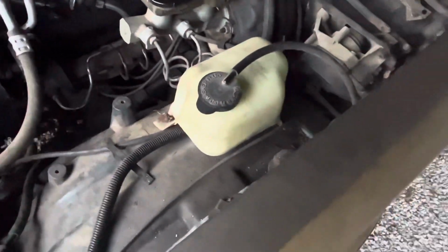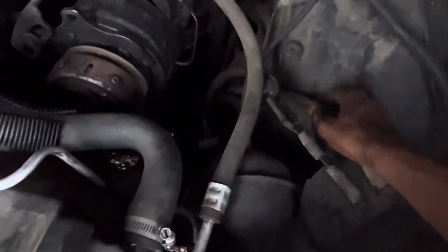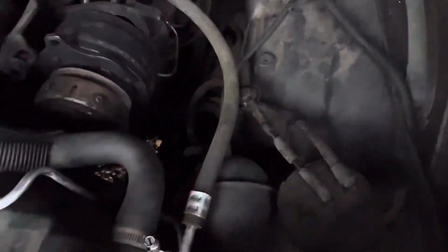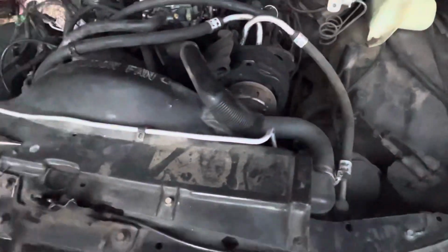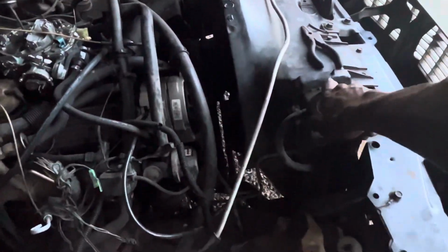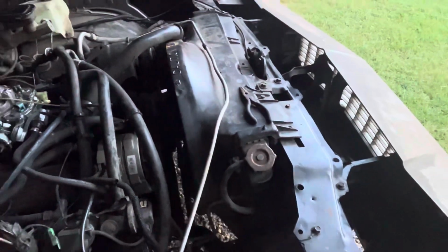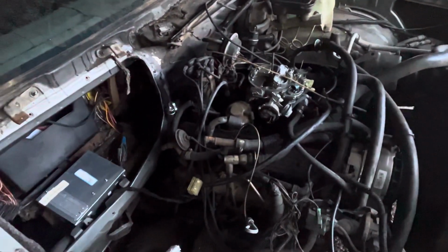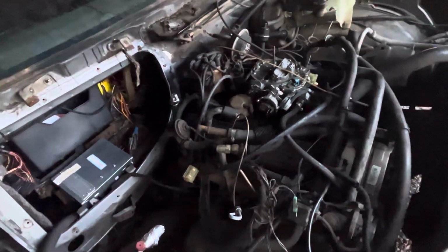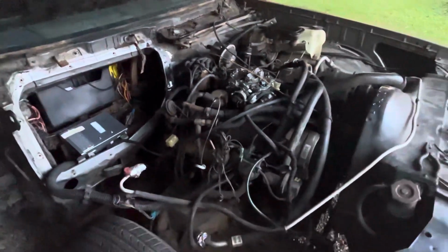And I'm gonna have to test and see if his windshield washer pump works. I'm gonna have to get down there and change that if it's not working. And like all these hoses and these check valves, all that's gonna get removed, and I'm gonna replace it with new hoses, just trying to make it look as factory as possible. The radiator is probably still good. We'll see if you wanna replace it or not, but we're definitely gonna get a new parallel flow condenser because we're gonna have to convert to 134A, because you can't find R12 anymore. So it's a lot of stuff that we gotta do.